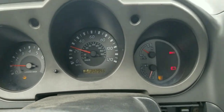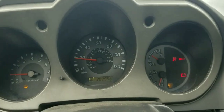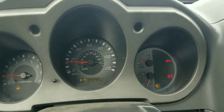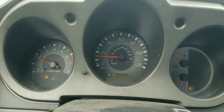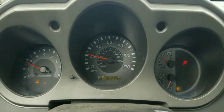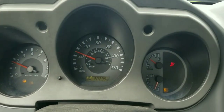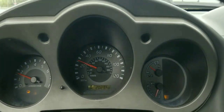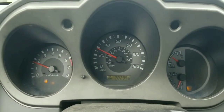Frontier D22. The best thing to do at this time, since the vehicle is driving, is to turn off the overdrive. This way the transmission could operate in 3 gears, allowing the RPM to most of the time ride above 1500 RPM, so the alternator could charge.